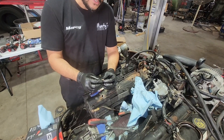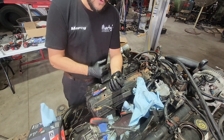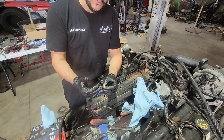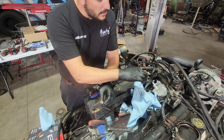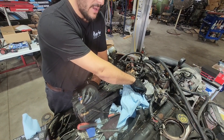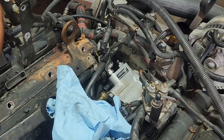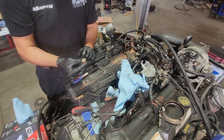These are the orange O-rings — they are the OEM O-rings, and they are number five ORB. I have used the ones from the hydraulic shop, but the Ford ones, for whatever reason, always seal better. I've had the best luck out of the OEM O-rings. On this particular truck I'm putting in the ones from the hydraulic shop and I'm going to keep a close eye on them, but he's going to get OEM O-rings everywhere else along here.